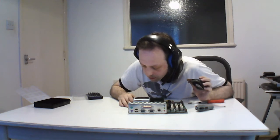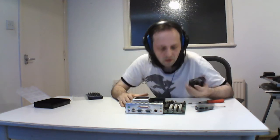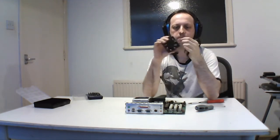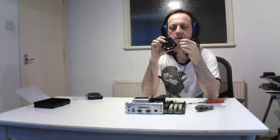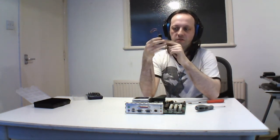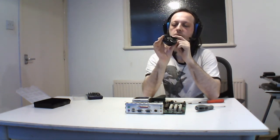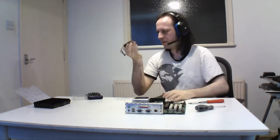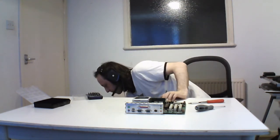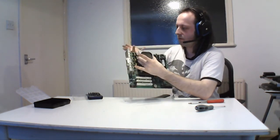Yeah, CPU fan, and the other one is the case fan. So that's that. It's a little CPU fan. It's 3 pins. That's speed control, so it will adjust the speed depending. And it was configured so the air went down and out the side. So that's the general thing. What you can do is get your brush and clean out better there. This thing really needs cleaning. First time I took the board out, so yeah.